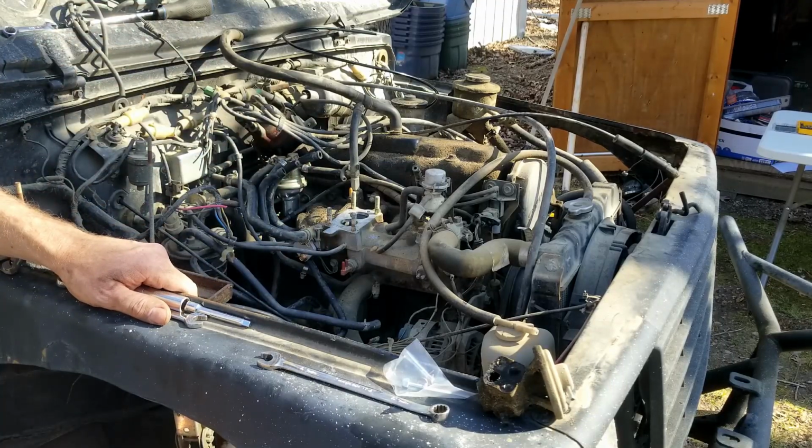Most rubber plugs will become hard and crack over time, and therefore these will need to be replaced sometime in the future. If your engine begins to run rough, check these vacuum locations. Even a small leak can cause noticeable problems, preventing the engine from running smoothly.